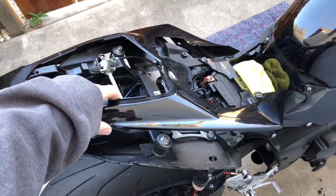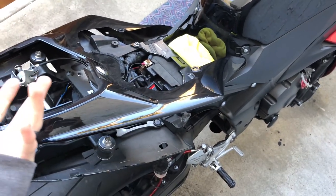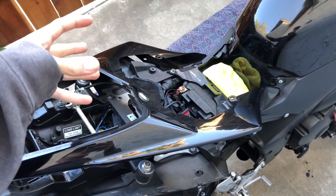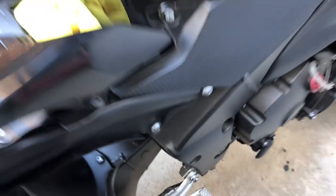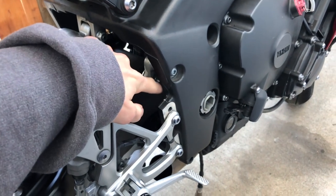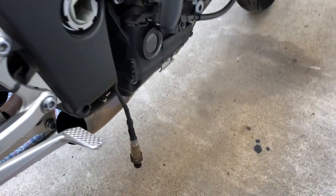Doing an update — we weren't able to record a lot last night because it got dark. For the mufflers, you just have to take off the top fairing — four push rivets — and then there are two bolts holding the mufflers, and they basically slide right off. The left one's easier because you can twist it; the right one was more difficult, so I used a rubber mallet to get it off.